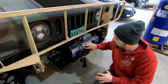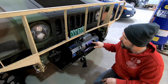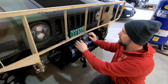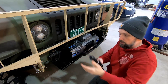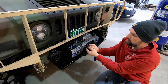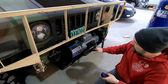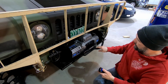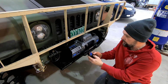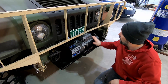It also has the option — which a lot of winches do — of synthetic rope or cable. I think everything's going to synthetic. I've personally been chewed alive by cable winches and had them dig into my hand and cut me up, so that's a nice thing not to worry about. To operate the remote, you hold down the in and out buttons for about three seconds, and then it's activated. You press the button and away it goes. It will deactivate in two minutes if you don't use it. You hold both buttons down and it shuts off.